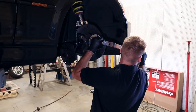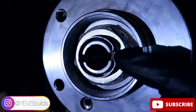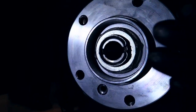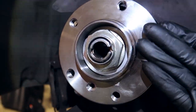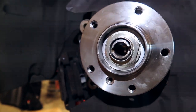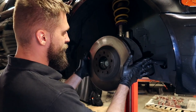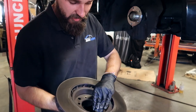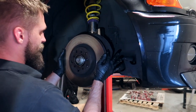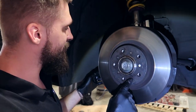Re-torque it again just to make sure — it's all seated. After you torque it down a few times and loosen and re-torque, this little locking nut ideally you'd want to replace, but since this bearing didn't come with one I'll just reuse it. Bend it back in and the nut is locked on the spindle. After that, clean the entire surface area off, put the center cap back on, put your rotor back on, and use some brake cleaner to clean up the rotor surface so it's nice and smooth.